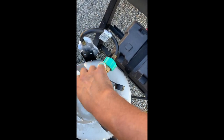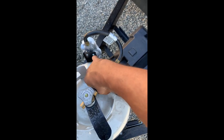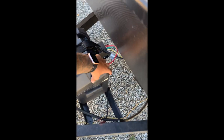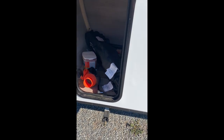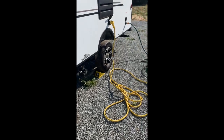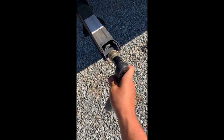Next I'm turning on the propane, simulating setting up at a campground. Once you're dropped at a campground, you turn on the propane, make sure your battery is fully connected, and the lid is closed. This is the storage compartment right here. In here you'll find the basics: a little ratchet you can use to drop the stabilizers, an extension cord, two lawn chairs, and the elbow for the sewer line.